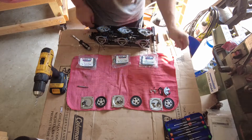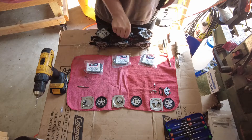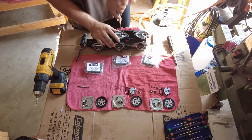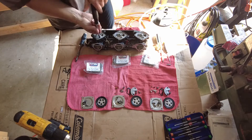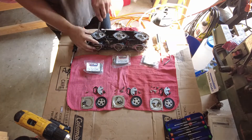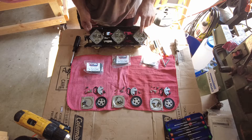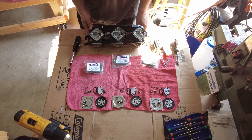Spring - I'll just make it a new thing. That holds the needle seat on. I'm going to pull the needle seat. We have this taken apart, all the gaskets off, all the jets are out, the float, the needle, the spring, the seat holder - that's probably as far as I'm going to take it. These seats look good but I'll inspect them later.